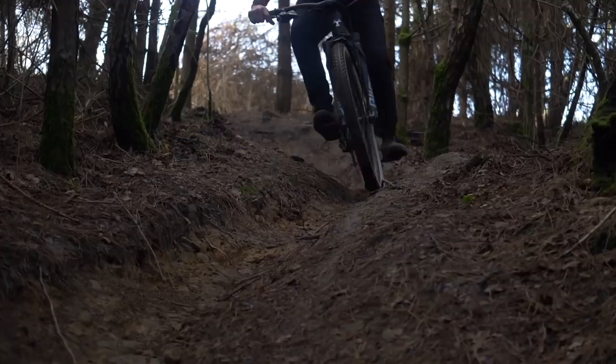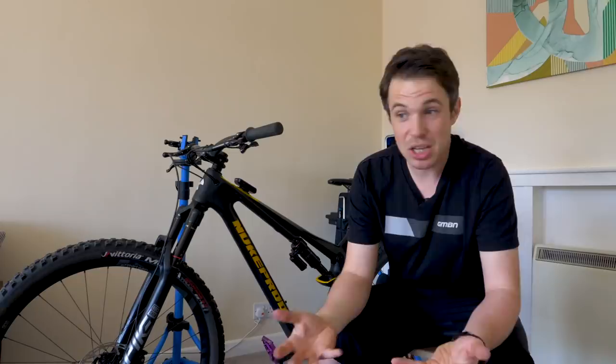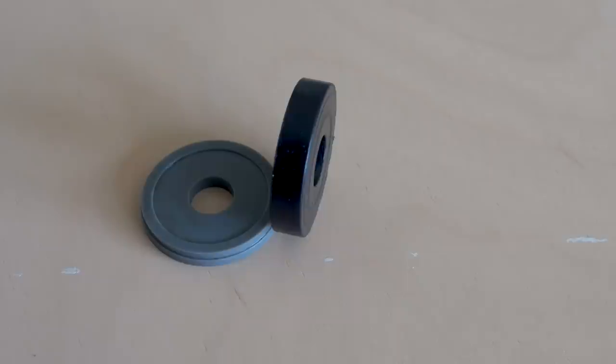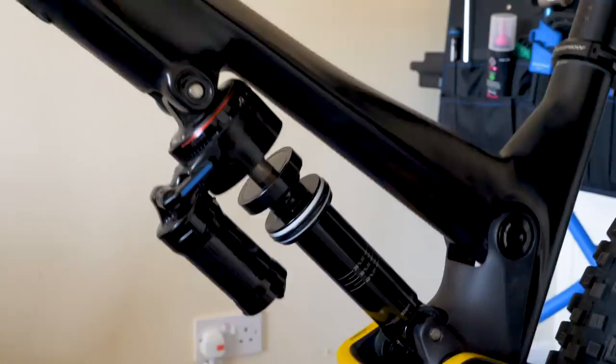People often ask whether it's easy to detect half a degree change or a small incremental change. Well, it depends rider to rider. I don't believe it's necessarily to do with rider skill, but more consistency — if you're very consistent in your inputs when riding, then when the output is different you can get an idea of what's changed. I also took out the 5mm spacer from the shock and replaced it with a 7.5mm spacer, which reduces the travel to 125mm at the rear axle. 2.5mm doesn't sound like much, but remember it's relative to sag — running the same 30% sag means the bike will run higher in its travel and the angles will be steeper as you ride, which really lends itself towards climbing.